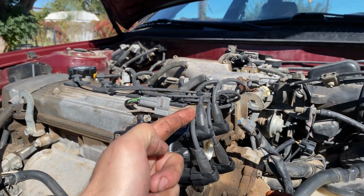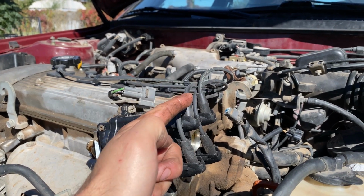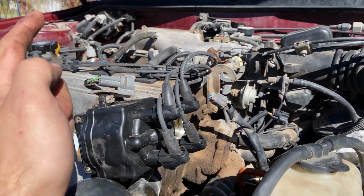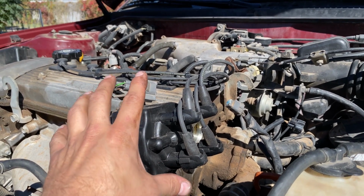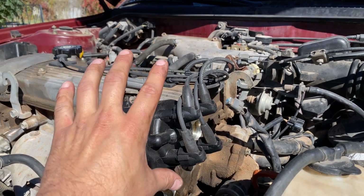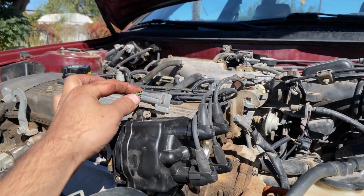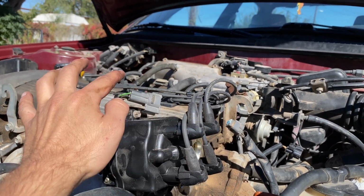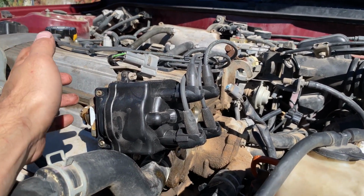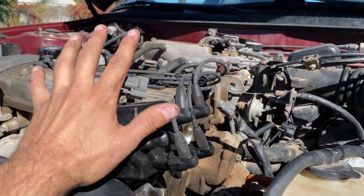Okay, mystery solved. I went on a little bit of a research expedition to the polar ice caps, no, on the internet, and it turns out in October 1994, all Corollas were switched over to a single non-adjustable distributor with a single plug. They did away with the 6-wire plug plus the secondary and did it all into a 4-pin single connector with a non-adjustable bolt.